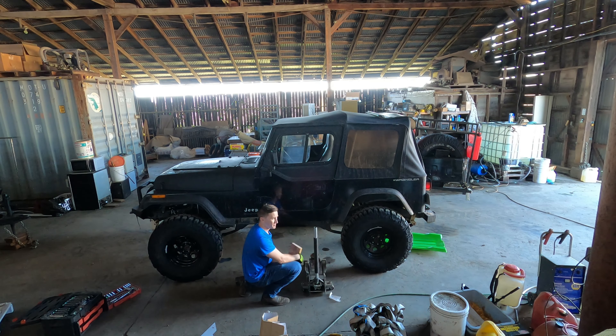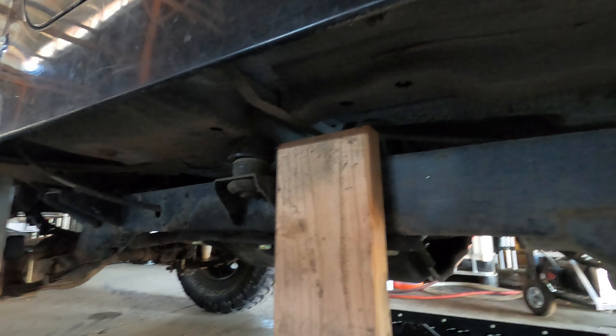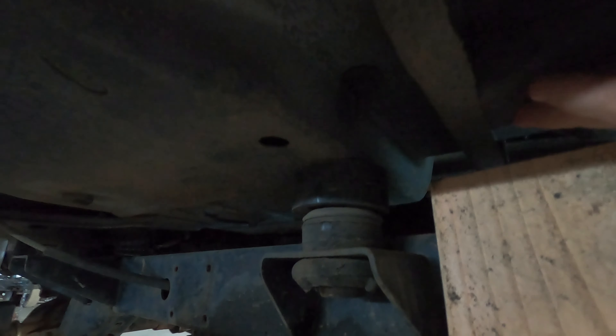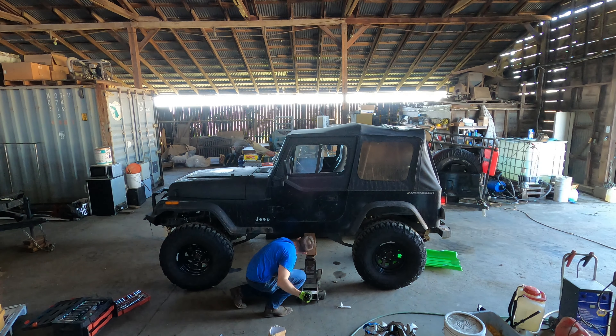This is probably not the safest thing to do, but we're only lifting the tub up maybe a quarter inch, so it is still securely attached to the frame. There's really no danger other than you want to be careful not to get your fingers caught between the tub and your body mount. The tub is pretty thin, so you want to be careful where you jack it up from. I found this little cross member here that adds some rigidity to it — if you try and jack it up elsewhere it will push your tub in.